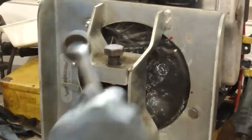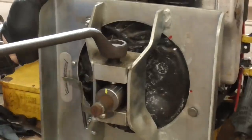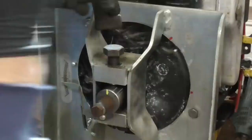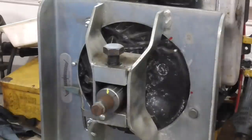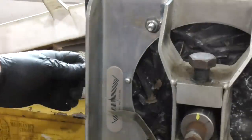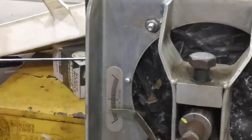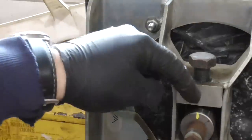When you tighten it, you've got to watch this arrow. I'm going to go to about the middle line — starting to get really tight here. Now I'm going to go back. There's always some spring, and you're never going to get this thing perfectly straight. If you get it within two lines, that's really good. We can see the needle's not quite as low as it was. Both bolts are loosened up — we're going up three lines and going down about seven lines, so we got a lot better. We want to go until the arrow gets down, and our yellow mark is right in the same spot.